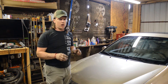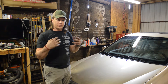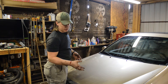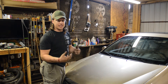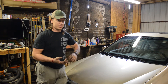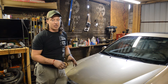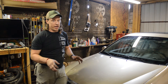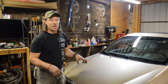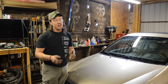The hardest part of this job really is getting that condenser back on the back, but depending on your make and model yours might be a lot less complicated. A lot of units come out all together and you just take off those pieces and put them onto the radiator outside the car. Everything else was a piece of cake — very few nuts and bolts, just a bunch of tubes and wires that you take off and are super easy to put back on. This is a job I could recommend anyone do with a limited number of hand tools — just some wrenches and sockets. And radiators are not expensive: this one was $45. For about 50 bucks you can swap out this radiator — that's a pretty good deal.